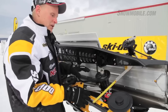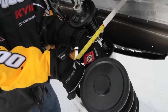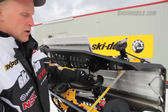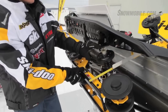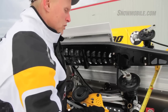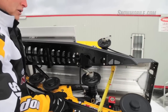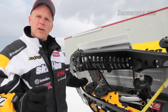We've also made this suspension extremely adjustable. For instance, you look at the coupling block back here — very easy to adjust by pushing the button and rotating the block. You set it where you want it: more transfer at one end, less transfer at position number four. The suspension uses a drop-link design that gives additional travel, allowing the suspension to collapse further up into the tunnel and giving you more stroke to absorb bumps. The front of the suspension uses a very long torque arm, which gives you a lot of control over your transfer. When you hit the gas in the middle of a turn, it won't tend to pick up the back and lift the front. This longer torque arm slows that down, making it more controllable, so the rider can control how well the skis stay planted with just throttle position and body movement left, right, or forward.